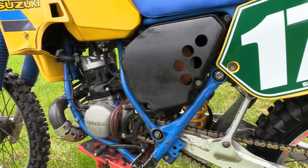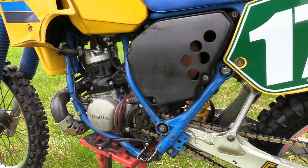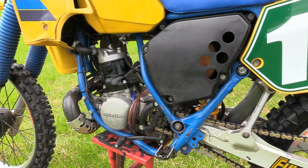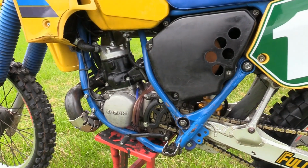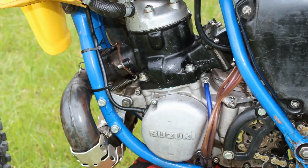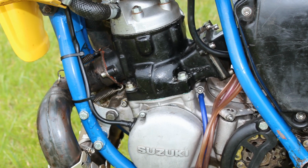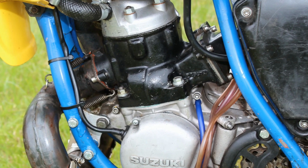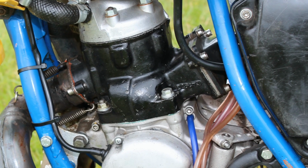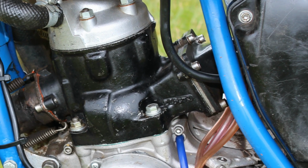But these 84 250s were, of course, the non-power valve models, which made it basically just a run-of-the-mill two-stroker, which had a reed valve block as part of the motor's fuel system, and these reed valve intake systems again kept the motor running very smoothly in all manner of racing conditions. And it was because it was fitted with this reed valve system that it almost eliminated that bogging down scenario that you used to experience with piston port two-strokers when diving into slow corners.